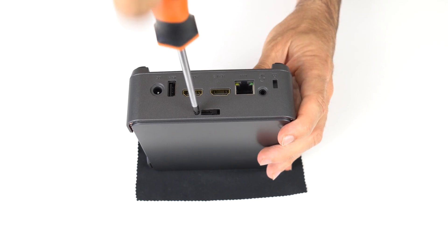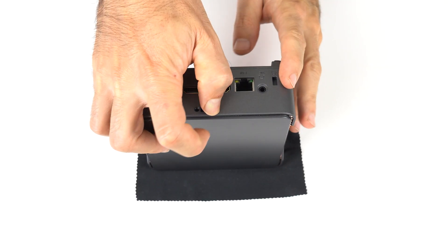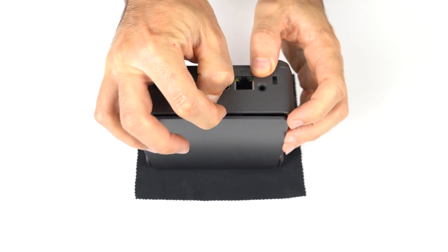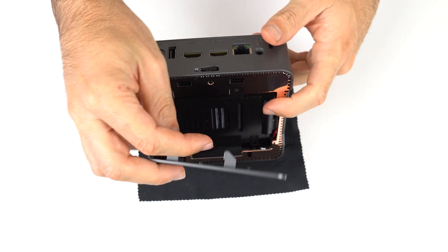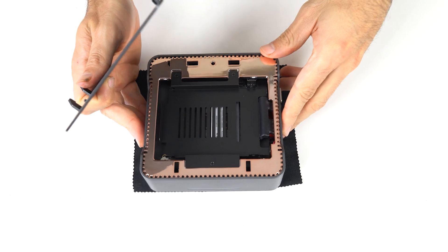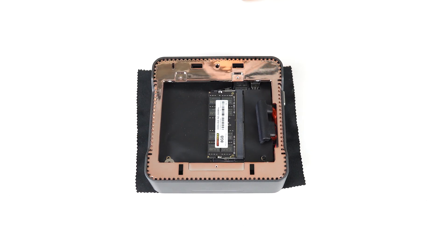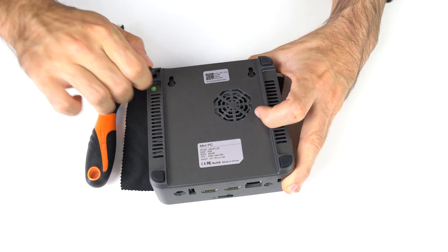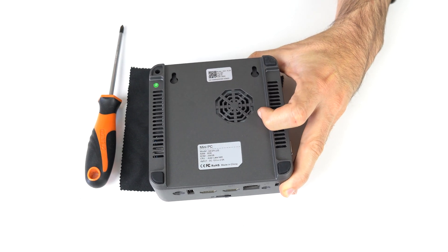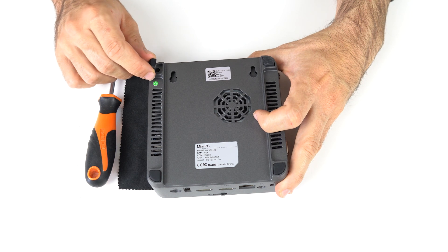Adding a 2.5-inch storage drive is pretty simple — remove the screw on the back and pull the lock to flip the lid. You can add your storage drive on the tray. Under the tray is the DDR4 memory slot with a 2666 MHz 8 gigabyte stick. To get to the storage drive, cooling, and CMOS battery, you'll need to remove the rubber feet and use a very long thin screwdriver on all four of them.